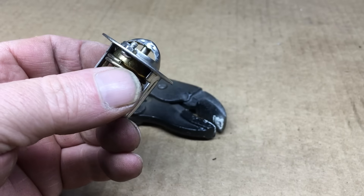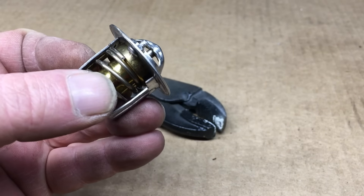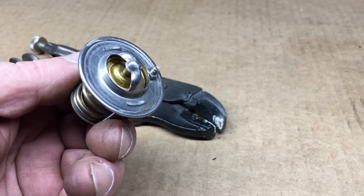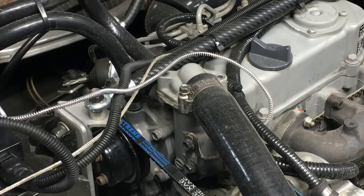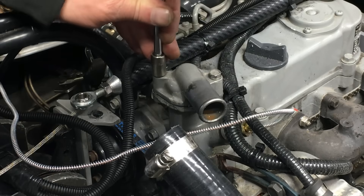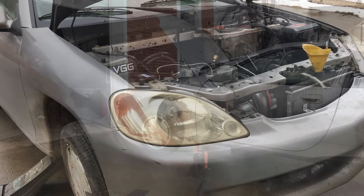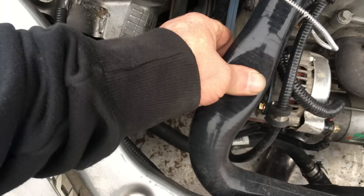This thermostat is made mostly from stainless steel and it would take a silver-type solder and a lot of heat to solder this hole shut. So I went ahead and installed a tiny stainless steel screw and nut. As a precaution, I went ahead and crushed the threads on the screw with some vice grips, and that's to prevent the nut from backing out. I'm sure it wouldn't hurt anything if these parts fell into the cooling system, but it would be nice if they didn't. Now, since I opened up the cooling system, I have to purge all the air from it. On this car it's a bit tougher because the highest point of the cooling system is slightly above the radiator cap, and I find it slightly easier to purge the cooling system with the front of the car jacked up.